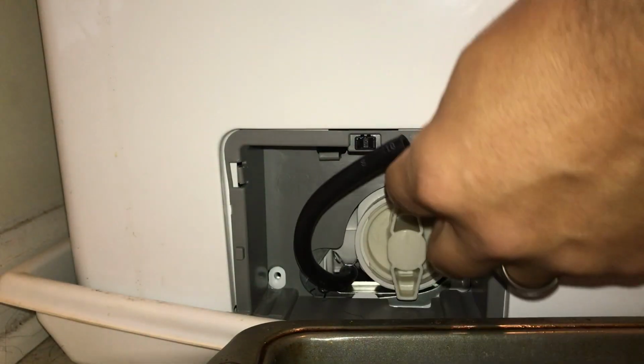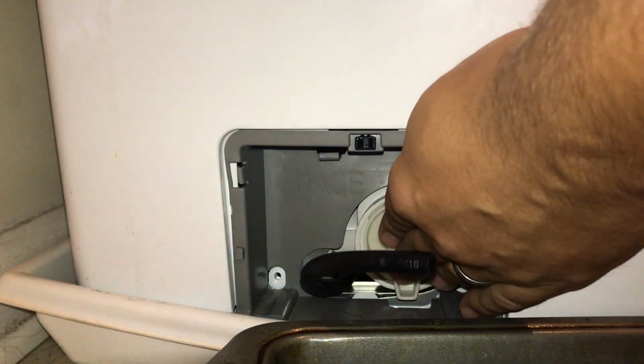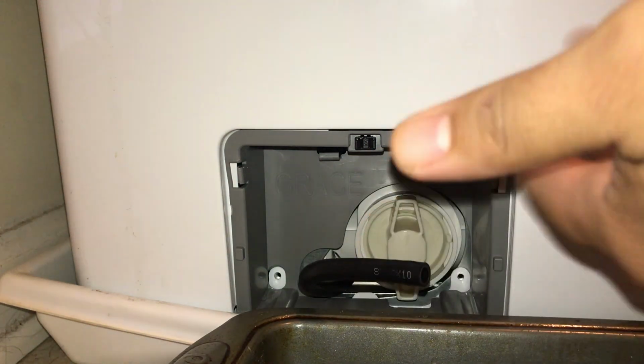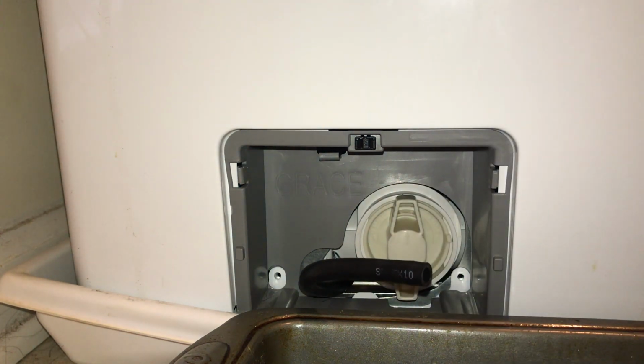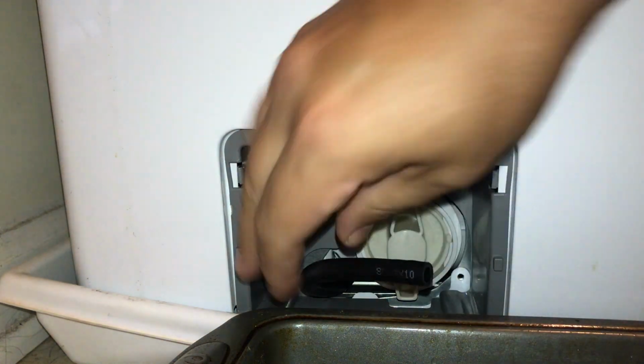will be a hose. Right here. Pull this little cap off. Pull the hose out, and this right here, now be careful, this will leak when you turn this. You'll turn this, pull it out. I just did it. Should have did it prior. I should have waited, but pull this out, and this is like your catch can. Anything that goes into the basin, change, debris, what have you, will end up in here. Pull it out, clean it.